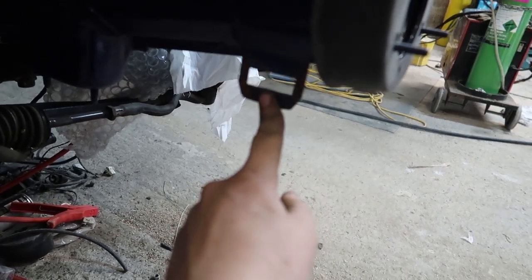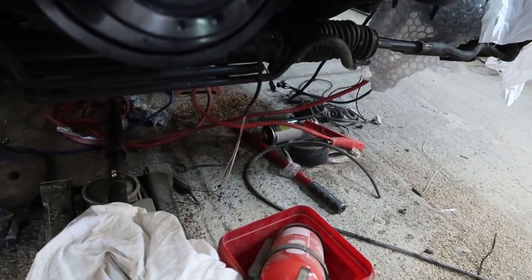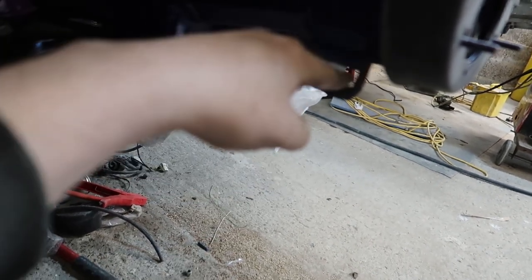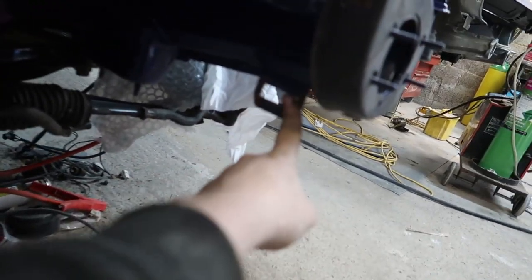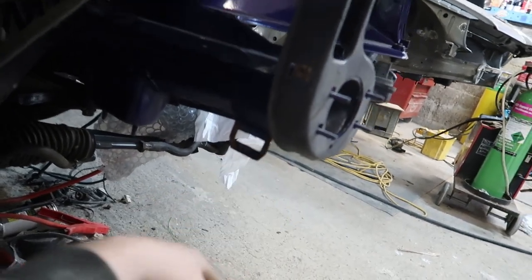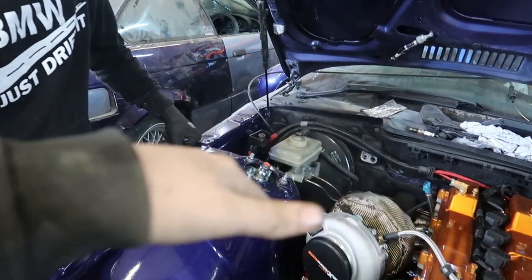The plan is, these are the factory brackets. I've got over there some square steel tube, 40 by 40 and 20 by 20. I want to make a piece come down, then weld a bit going along and drill two holes in it with some rubber grommets — because on the bottom of the SR rad it's got two bits that stick down like this where it just sits on a rubber grommet. I'm going to drill some holes and then put a plate on the front and basically bolt it to the factory one, so then I can unbolt it and take it off. I think it would be better to just have it so I can unbolt it. This is a factory bracket for the radiator so it should hold up reasonably strong — the radiator doesn't weigh that much. Then we'll have some brackets coming from the top of the rad to here somewhere. But let's wrap up the radiator with some cardboard so we don't damage it.